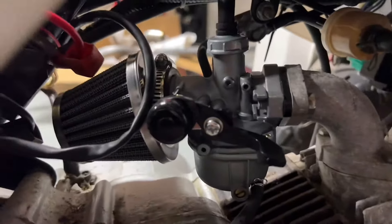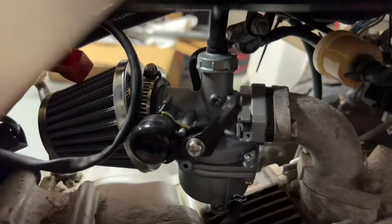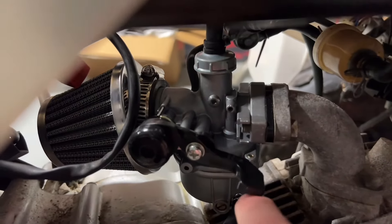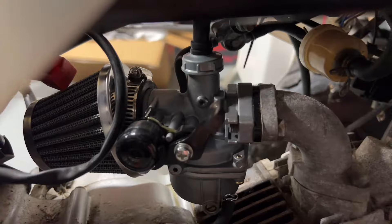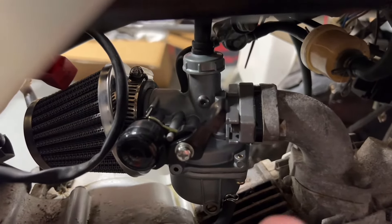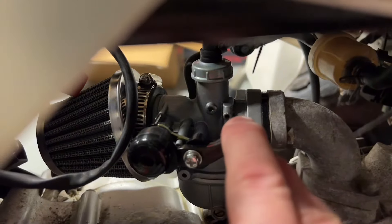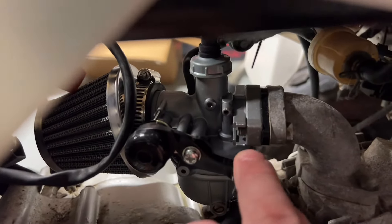Round on the other side, just in case you're not sure: up is choke on, down is choke off. You'll need choke on for the first 30 seconds or so while the bike or quad's warming up, and then you should be able to gradually go to choke off.